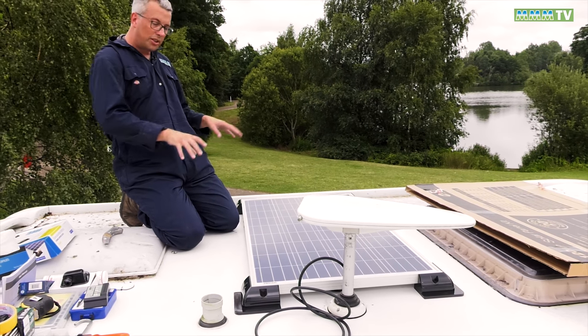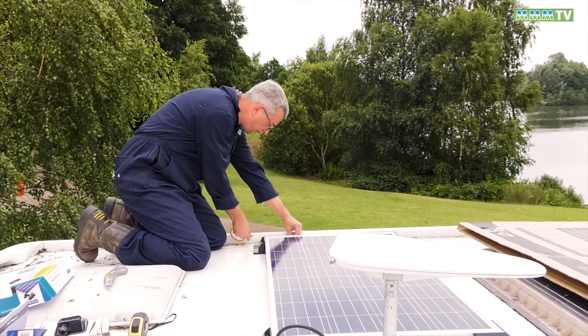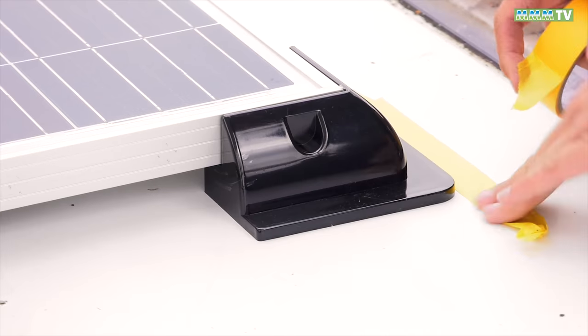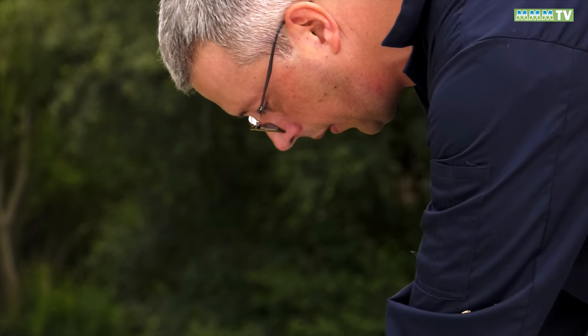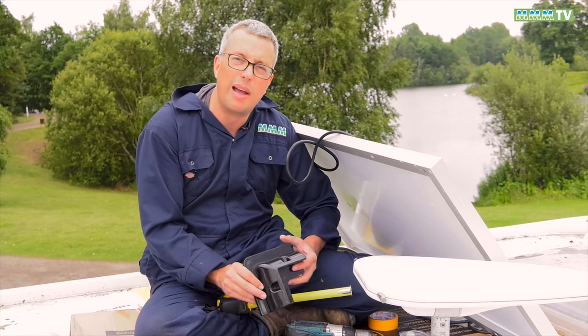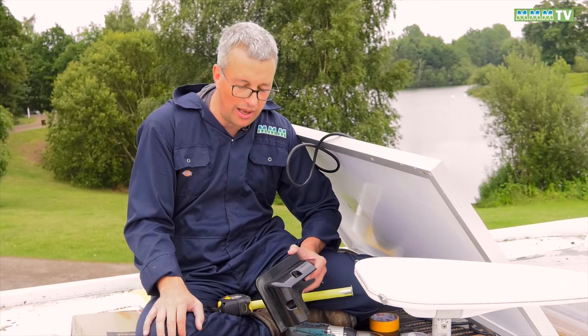It's roughly in position — just mark the position of these feet, because that's what we're interested in. Where the feet go. This will also stop mess from the sealant. Now we could just glue the feet straight to the roof, but the problem with that is they might get misaligned. So I think it's a better plan to attach the feet to the solar panel first and then bond the whole thing in place.